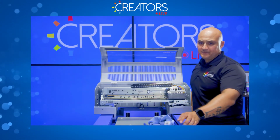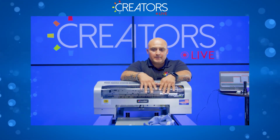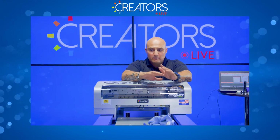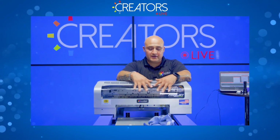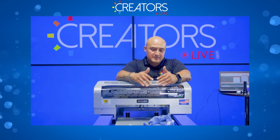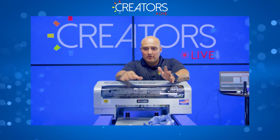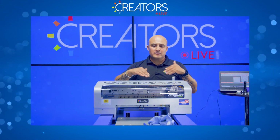All right, what else? You pre-treat in the same room where you have the printer. I strongly suggest you work something out to cover that pre-treatment area, so the pre-treatment mist won't end up landing on your printer. Otherwise, you're gonna have a really sticky touch on the printer, and that's not a very good thing because it might end up damaging some parts of the printer. So consider moving the pre-treatment area to a different room or covering it, so the less mist is floating around the room, the better.